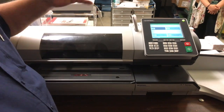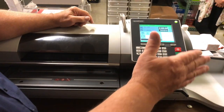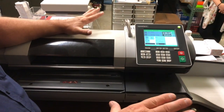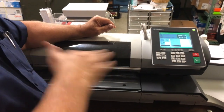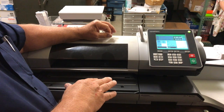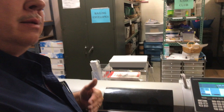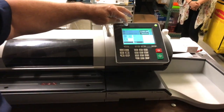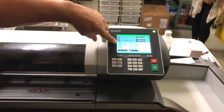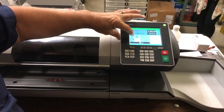There's a dynamic batch mode — I kind of like it if you've got a lot of mail that's all the same. Put it in batch mode, hit start, it'll run one and pause and say do you want to put this postage on it. Hit OK and it takes off, twice as fast as dynamic mode because it doesn't have to weigh it. It still measures the length to make sure you don't have jams or double feeds. The icon looks a little different — it's got single-single-single behind it, and it also says the word 'batch.'